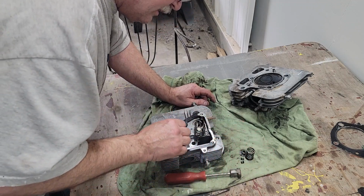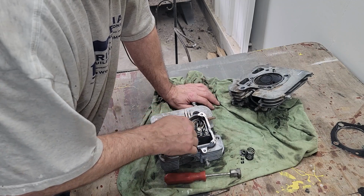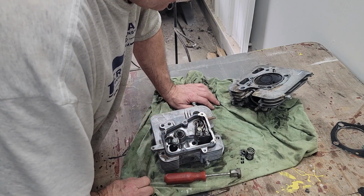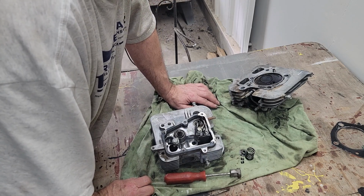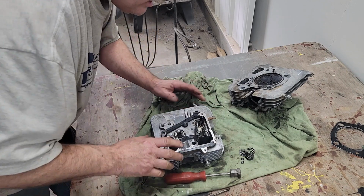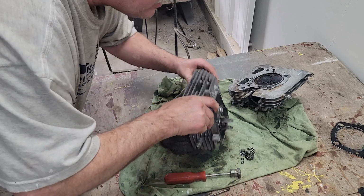Spring. And like I said, the way it's oriented, the intake valve's way up in the air. The oil level was so high in it, it's right here at the valve. There's a brown spot there. Design, maybe they thought that it would keep the valve cooler, floating in oil more. Maybe why they design it that way, who knows? But I wouldn't want them in that much oil, worried about a guide leak or something, you know.